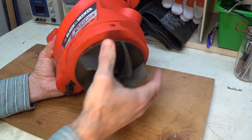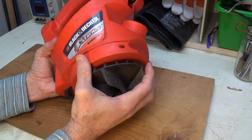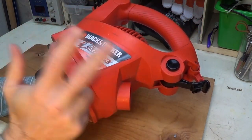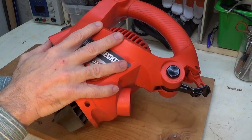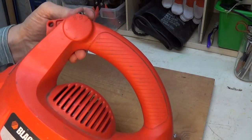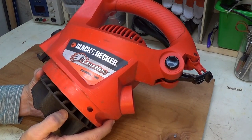There are some housings here that kind of blow the leaves. This is just the fan, and it can actually suck the leaves as well, depending on which housing you put on. But this is just the motor component. Last time I used this, it was working fine, and it just — bam — turned off. I didn't smell any smoke or rubbery or plastic smell, so I don't think it's the motor itself. I think it's the switch, and I've been playing around with this two-speed switch, but nothing seems to be working. I fiddle around with the plug, and nothing seems to be working. So I'm going to open this up and see if I can figure out the issue.